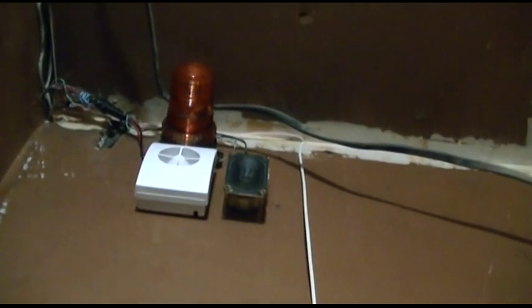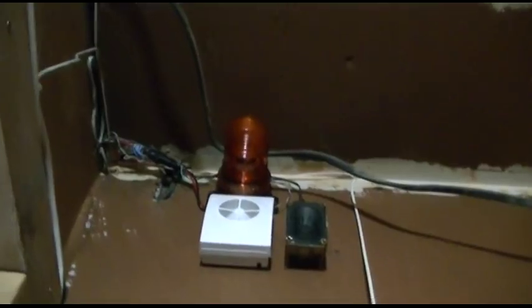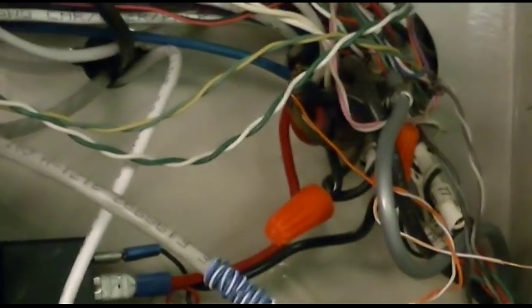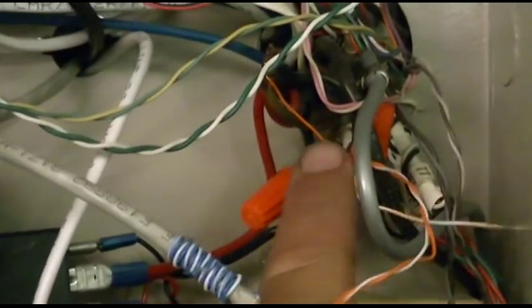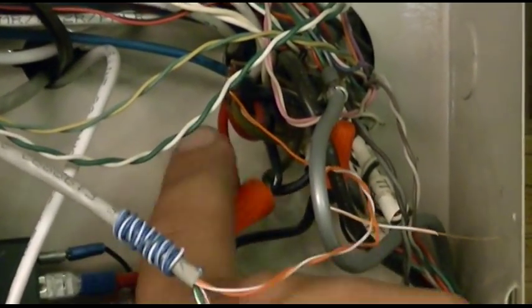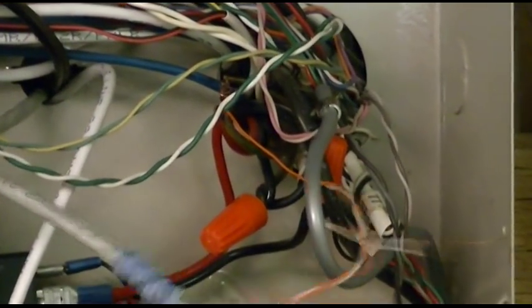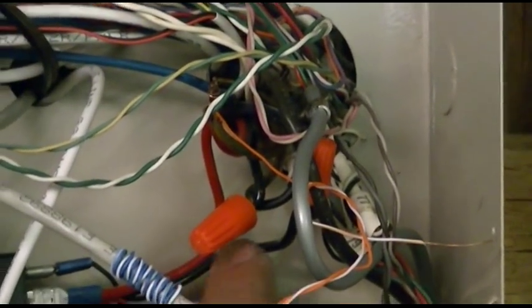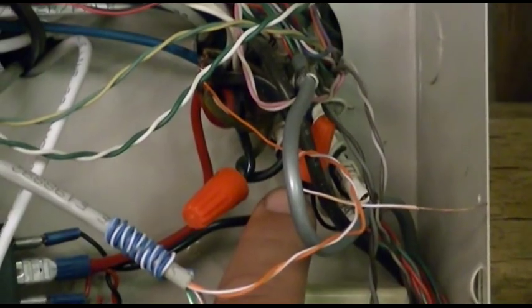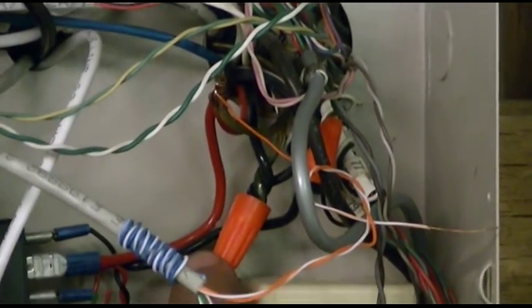If I had another amplifier for it, it would certainly work better, but I'm just using what I got, so that'll be enough for now. We'll start with that. Now we'll wire up the rest of the stuff. Okay, wiring in the strobe. For some reason I didn't leave myself much slack. This is all the wiring I did with this relay and these wires here. There are two red wires and a speaker-looking wire. The speaker-looking wire goes to the strobe over here, so I know that that's the output wire. That means the black wire, which goes to this wire nut, is the input wire — so this is always live. And that means this is the one where the negative gets connected. So I'm going to re-wire-nut that before anything else falls apart, take that off, and then put the negative wire on there.